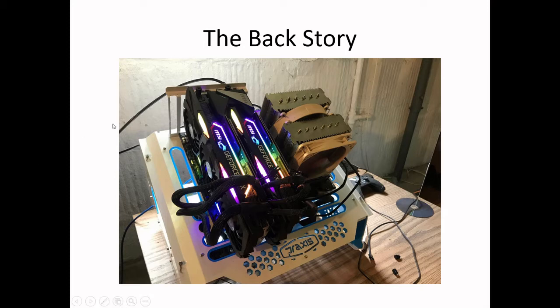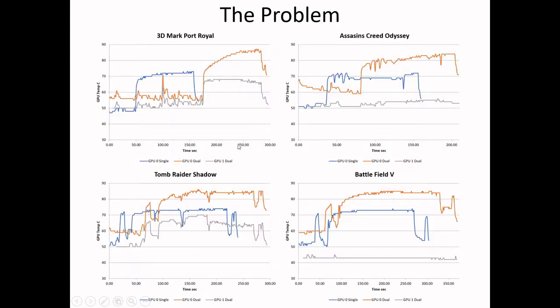As it turns out, this is actually a very, very bad way of putting two of these very expensive cards together. Because as you can see, there's no space in between the two, so the air cooling on the inner card is horrible. And it's not a good thing to have this card run so hot. So what I decided to do is actually do some temperature measurements.